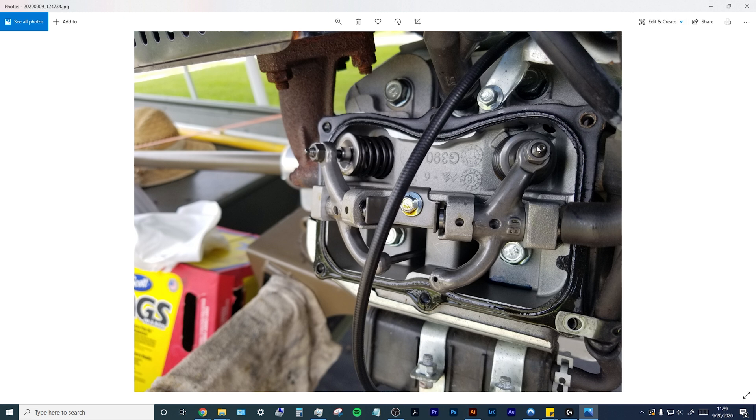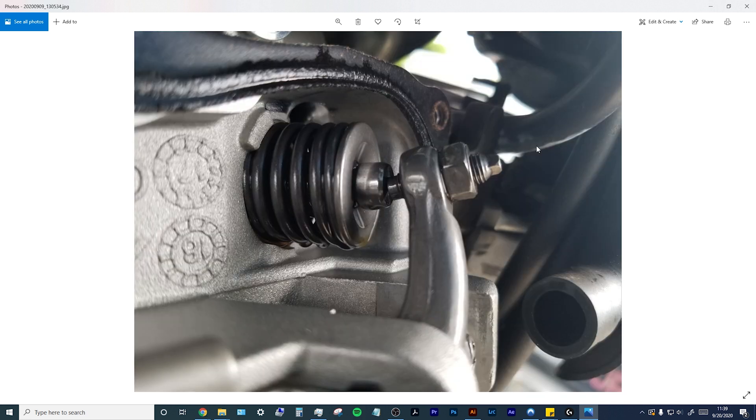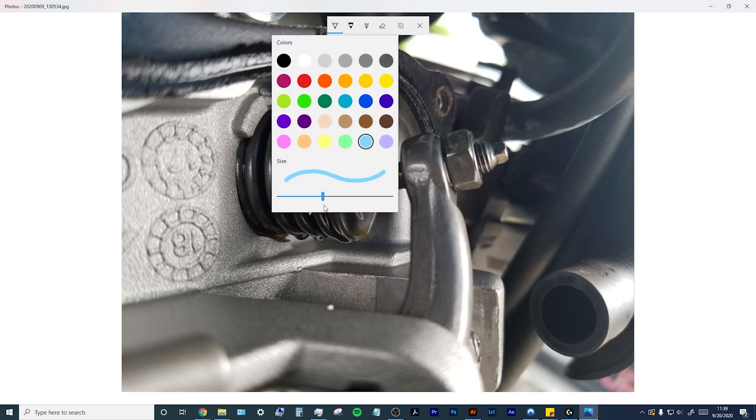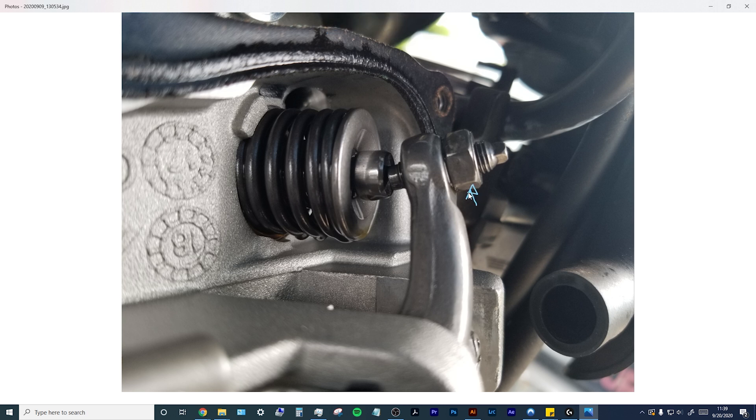Once you've got the exhaust at the very top, you can see it a lot better. Let me do some drawing here. This is your lock nut — that's what keeps everything tight. This is how you adjust it. Right in here — that's where you stick your feeler gauge in. Not down here — that's a no-no, it doesn't fit in there, it won't go through. Up in here is where you want to check. In between this and this — stick your feeler gauge in there.